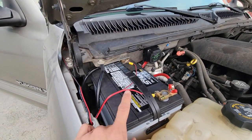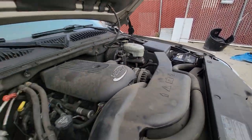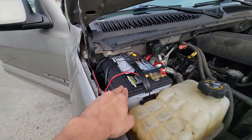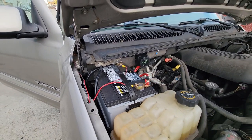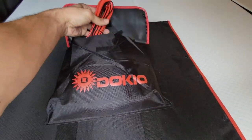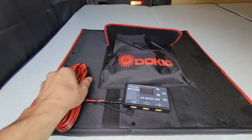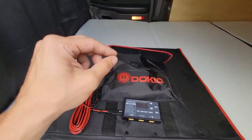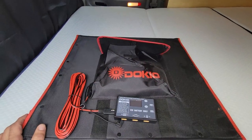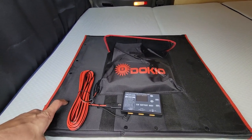Here's the secondary battery — a 75 amp-hour battery connected through a smart isolator to the driving battery. The engine charges both batteries, and this battery should last overnight to power all the electricals as well as the fridge. We also have a 160-watt solar panel kit that comes with its own wiring and solar controller, all in one kit. It has alligator clips to connect to the deep cycle battery so that when the rig is parked with plenty of sun, you can switch to sustainable solar energy.